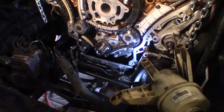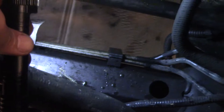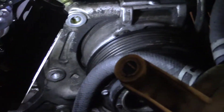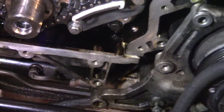We now have the pan loose, and I will tell you that loosening up the AC compressor bracket is definitely beneficial because the pan's going to start to rotate and that bracket's going to be in the way. So the shop manual is correct — you'll have to pull the bolts out of the bracket and it'll just sit to the side a little bit. You've got to really be careful and make sure you get every last bolt out. I actually had one I missed, which was a little frustrating — I had to find out it was hanging up, and sure enough there was another bolt in there.